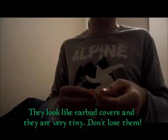Okay. Set the mainly plastic part down, and the button side part with the circuit board down. You may find on the plastic part these two little plastic things. Keep track of these, as well as the screws you took out earlier. Just set them aside. Now on the circuit board half, unsnake the cable, and you'll find that the circuit board just pops right out. Under it are the rubber receivers for the buttons.